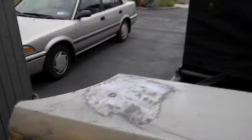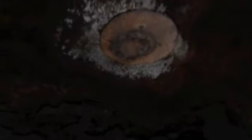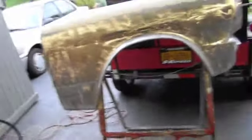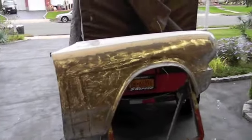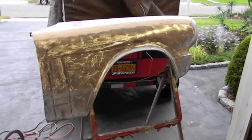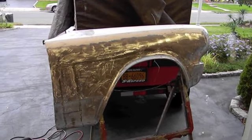I put a plate underneath it — I wasn't going through that aggravation. I'll seal that up; that definitely will not be an issue since it's not even in the area where water would hit. The main part of the fender I did with 50-grit discs, but anywhere near the well, around the edges, I did it with a fine brown disc. I'm not even sure what the exact numbers are on these 3M discs, but they're fine — you use them to take the gaskets off or whatever. I didn't want to destroy any of the edges.